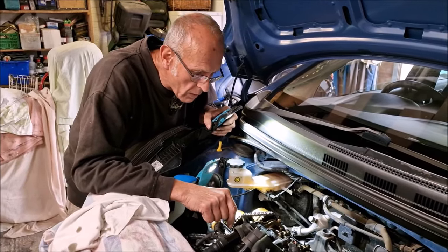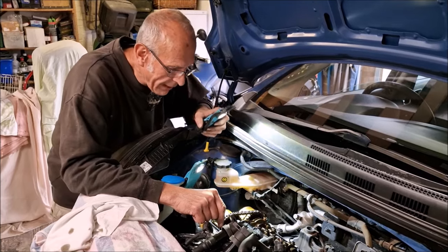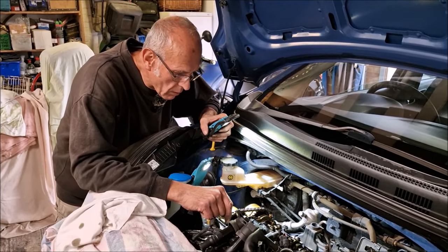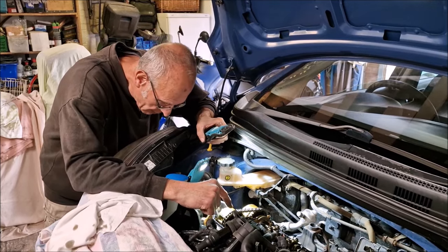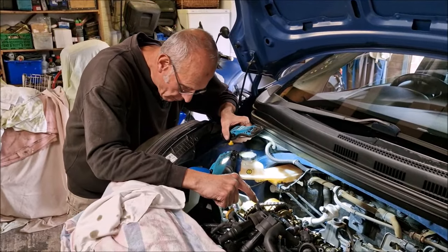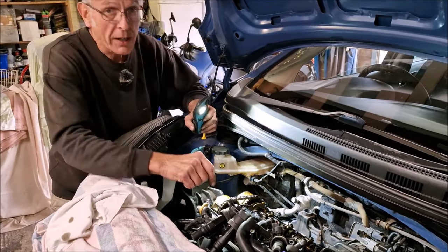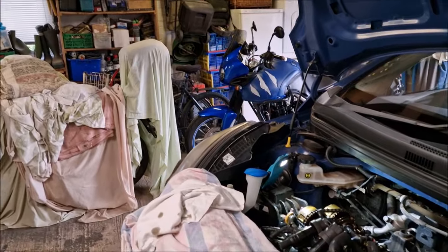Right, so we've got them marks in the right place, and that obviously means the engine is timed. We're somewhere near enough now. For people that don't understand the importance of why we've just done what we've done, what is it that we've done? Just tell us. We've put it on TDC number one. So when we put it together, the marked links on the chain, which I showed you earlier, will be on there. So the engine is top dead centre, or the piston is top dead centre. Not like your Rover, you do these at the top. We're all right.